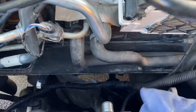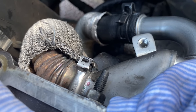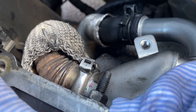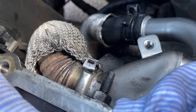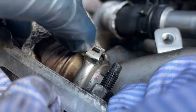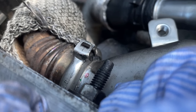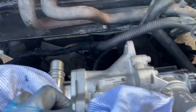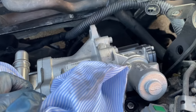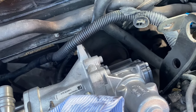I've managed to get the various nuts and bolts done up. I've got the lower hose connected and the exhaust pipe connected, but I have to say that exhaust pipe clip is an absolute pig to get on. I tried pliers and mole grips and eventually got there with the mole grips, but it took a hell of a long time. I managed to get the little hook at the bottom of the hole and then tap down the far side to lock it over - an absolute nightmare. I still need to put the other coolant pipe on and the exhaust gas pipe through to the throttle body.